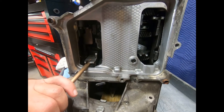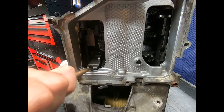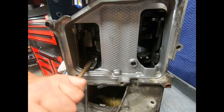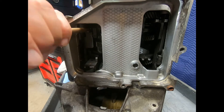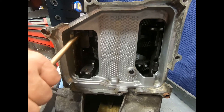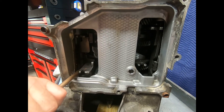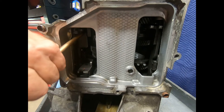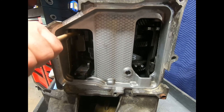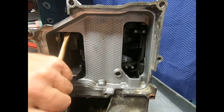As you assemble the transmission, we want to make sure I'm able to shift through all the gears without any problem — make sure the shift forks move smoothly without any trouble whatsoever. Here's the big offender right here. What happened is I lost my reverse shift fork because of the ball bushing in the case — it actually broke up, as we saw in the earlier section. But now it's moving very smoothly, so I should have my reverse without any trouble.